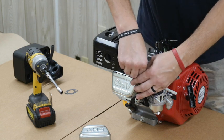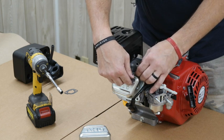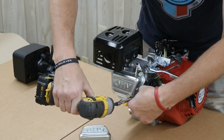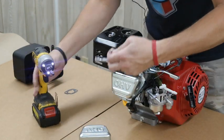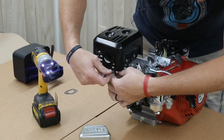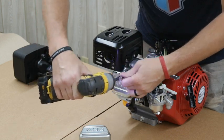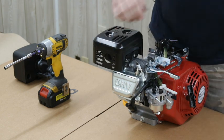A little extra bonus while you've got the valve cover off — especially on a new engine — it's always a good idea to check your valve lash. We recommend four thousandths on both sides, intake and exhaust. We're going to start all four bolts back in, being careful not to cross thread them. This one can be a challenge, and it's a lot simpler if you just remove the muffler. Since I've got the weeble wobble extension I won't have to do that. Now we've got our pulse valve cover installed.